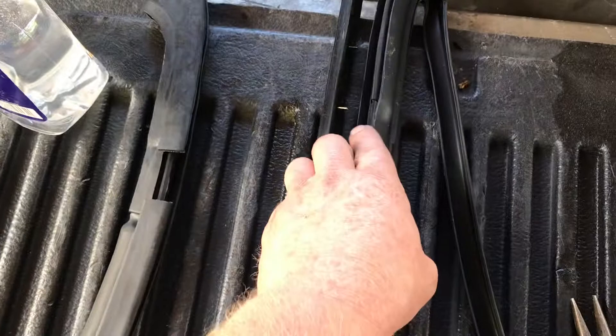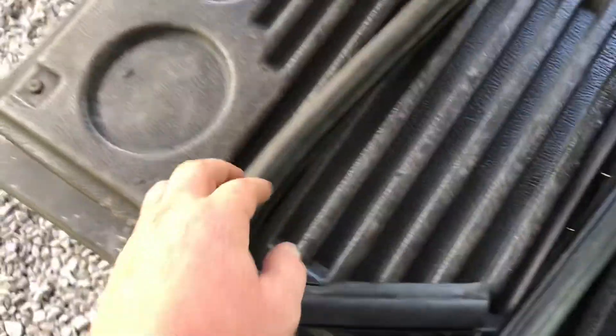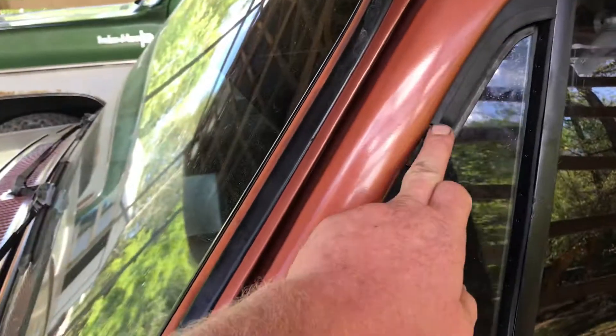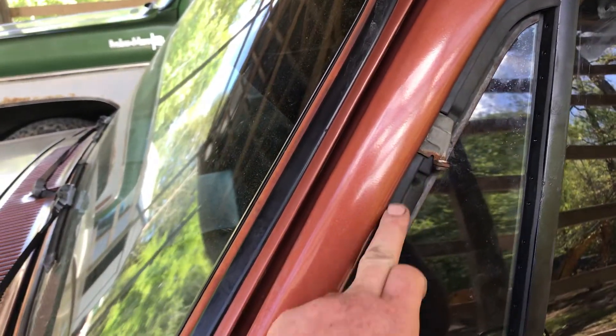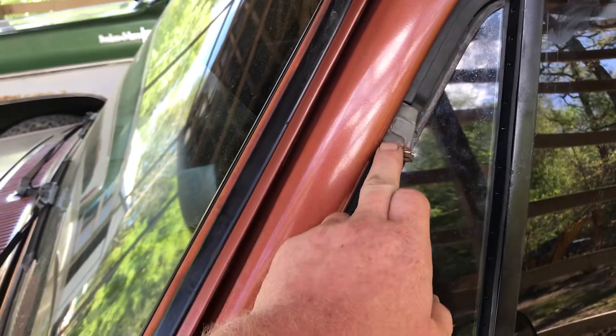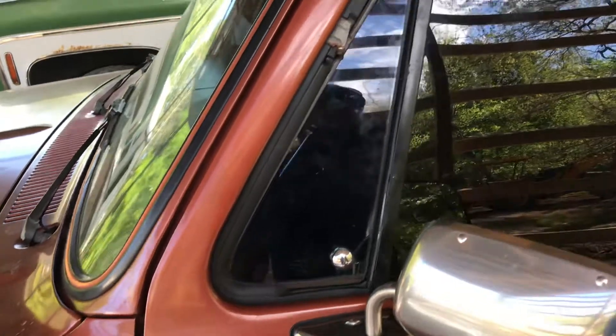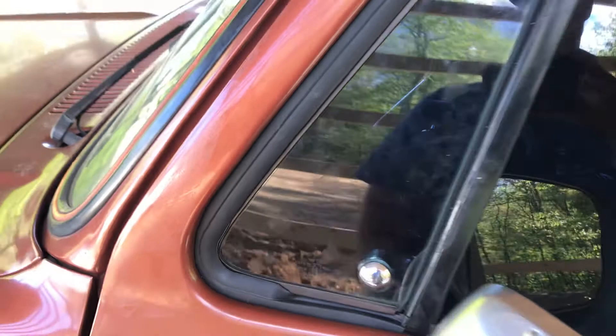The easiest way I can show you: the two-piece has got this big cutout spot — the one-piece does not. This is my new seal for the passenger side, and right here is what I'm talking about — you're going to have this little hinge. From what I can tell, the two-piece is open there; the one-piece will be covered. So if that's covered on yours, you have the one-piece seal.